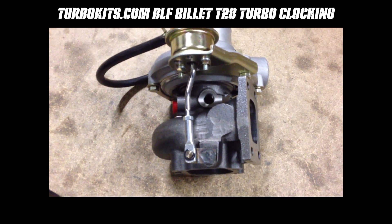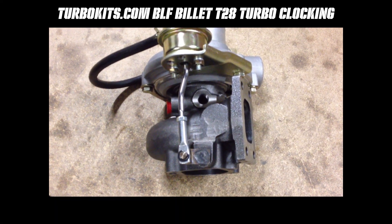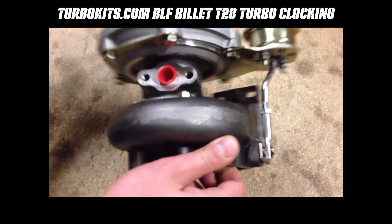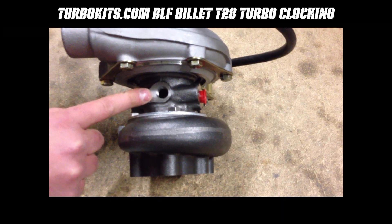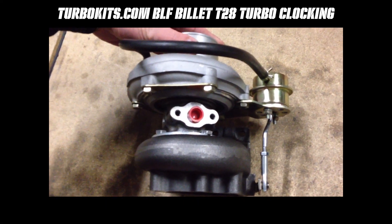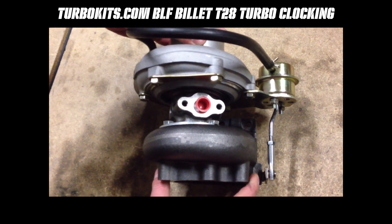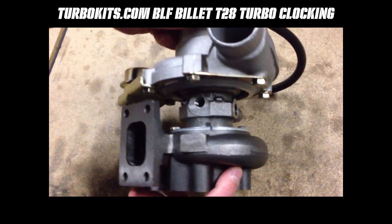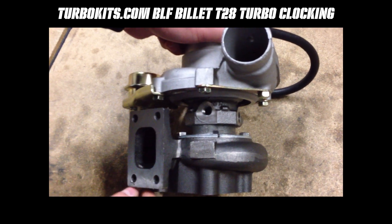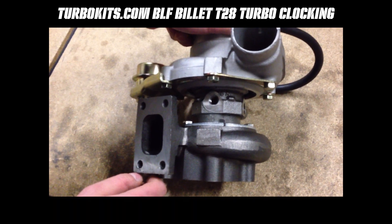The next part you need to know about is the oil inlet and outlet, the water lines, and what's considered the center section of the turbo — the CHRA. Here we have the water ports; those are typically side to side, one on each side of the center section. On the bottom with the little red plastic cap is the turbo drain — the diamond-shaped flange bolts to that with a fitting to drain the oil back to the motor. As you flip the turbo around 180 degrees you'll see a threaded piece — that is where the oil inlet or oil feed line goes. Most turbos use a dash-3 or dash-4 line, so the fitting would have to be a dash-3 or dash-4.